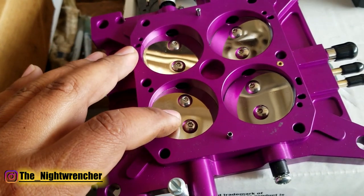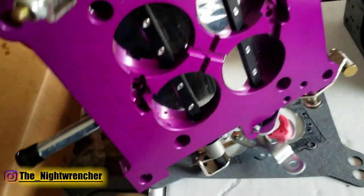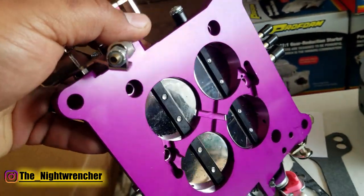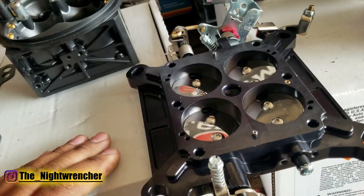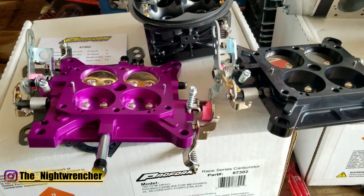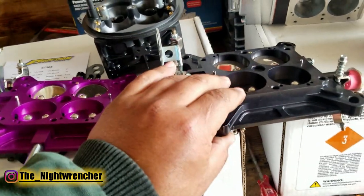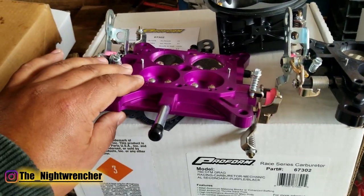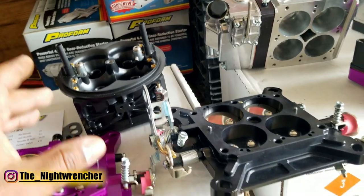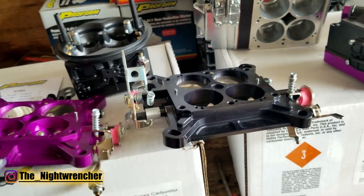On top, both carbs have stainless steel polished throttle blades held down by low-profile panhead screws, bolted onto a reduced-diameter throttle shaft — not the half-moon throttle shafts seen in older style carburetors. The main purpose is to reduce restriction going into the plenum for better flow. Also, the updated base plate is actually taller than the older one by over 100 thousandths, and while that doesn't sound like much, that extra height can make a serious impact on reducing air turbulence entering the plenum.